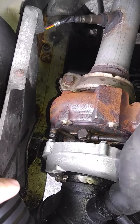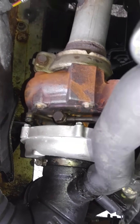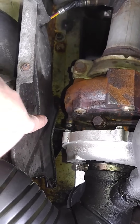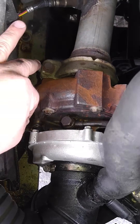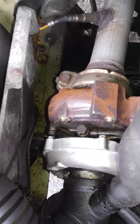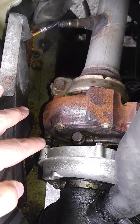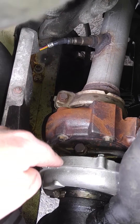I said it's got to be something simple. So I took the link off and threw the arm to the side to see if the actuator worked. I had another guy with me, I said start the van, see if the actuator moves. The actuator arm was sitting against the heat shield and when I turned it on it was moving up and down. I said let me check the wastegate — opened and closed it, heard the engine bog down and start revving a little higher. Everything seems to work. After he shut it off, I tried putting the arm back on and now the arm was lower than it was in the first place. So it tells me I had to clock the turbo, and I called the turbo guys and they told me I had to clock the turbo.